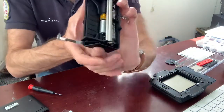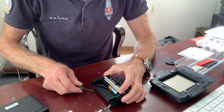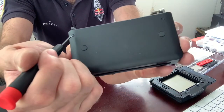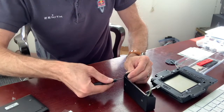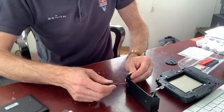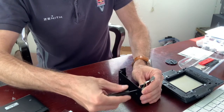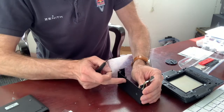That's how it looks. The battery is inside here — you can see the original battery pack wrapped in Kapton tape. It may or may not look the same; some of the old packs have sealed wrapping. The next step is to take the cover off. For that we need to remove these two screws — again Phillips 00. Use a small tip screwdriver; don't use a big one or you'll strip the threads. Loosen them with your fingers or a pair of tweezers and safely put them away. They may be longer than the other screws, so remember that.